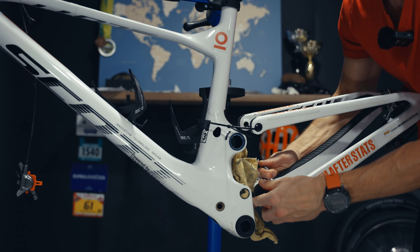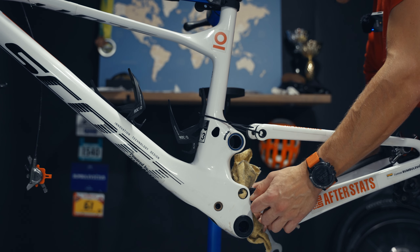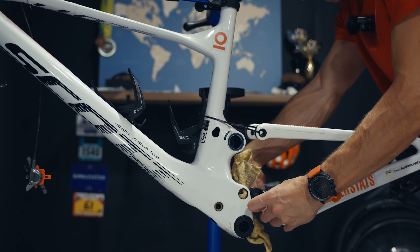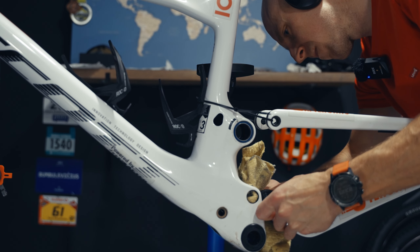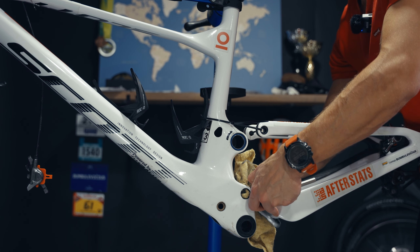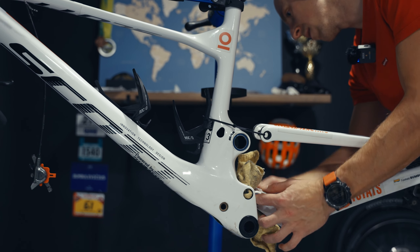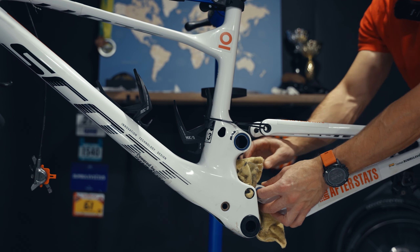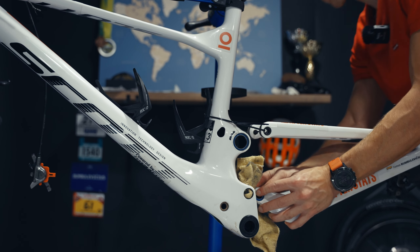For the tool I made for pressing this bearing down, I applied additional spacers on the non-pressing side in order to offset the distance and not scratch the swingarm, because it doesn't go straight down but goes at an angle. I press down the bearings to the point where the inner tube doesn't move. In the past I noticed that if there's play inside that tube after unscrewing the bottom axle, there will be sound during suspension movement. So to prevent that I press the bearings a bit more — maybe it's not ideal, but I'm certain there will be no additional sound from the suspension.